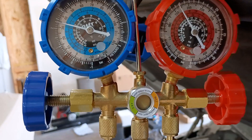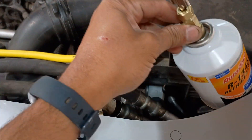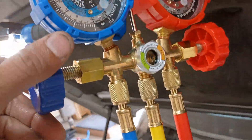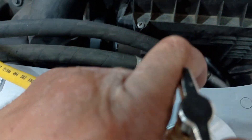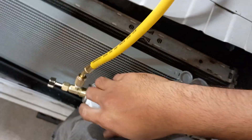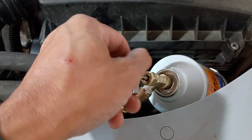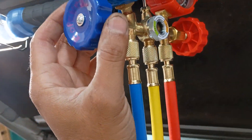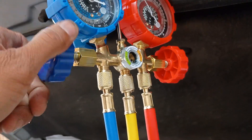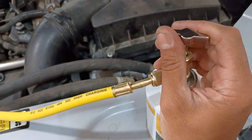As I went to release it, a little more came out and I'm now running closer to 35 psi, so I let it go a bit longer. The can is now warm and no longer letting anything out, so I close off the gauge valve and then close off the can by turning the valve counter-clockwise to raise the pintle all the way up. I swap in the next can, open the valve up, and tighten it down.